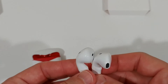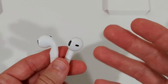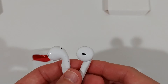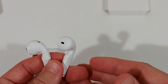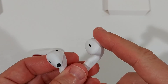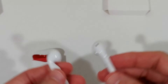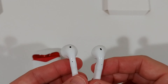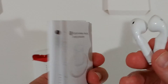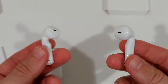Pairing was easy on my phone but trickier on my PC — I think that's an issue with my Bluetooth adapter. One quirk: every time I reconnected, the volume was at 100%, which is very loud. I was able to switch back and forth between PC and mobile phone after a few tries. At one point it connected to only one earbud, but switching back and reconnecting fixed it. There doesn't appear to be a reset button — it's not in the instructions either.